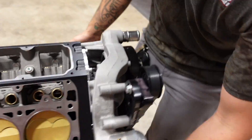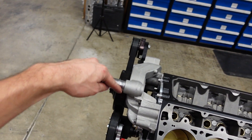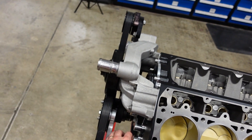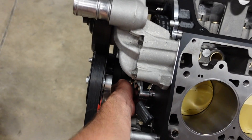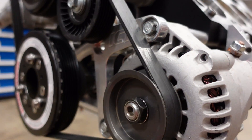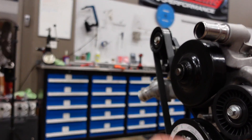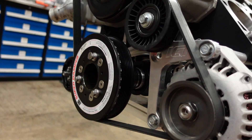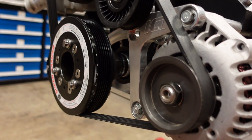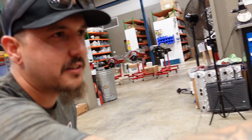This side is easy because the turbo is going to be about here. I can run my turbo drain straight through this massive opening cavity and shoot it right into the timing cover, which could be drilled and tapped — that billet's pretty thick. So the theory is we can drill it and machine it, and I've got some welding bungs that would weld into that timing cover. That's an option where we could go with an ORB if it's machined and threaded — we could actually tap it. Because it's thick enough billet, we have plenty of material there.